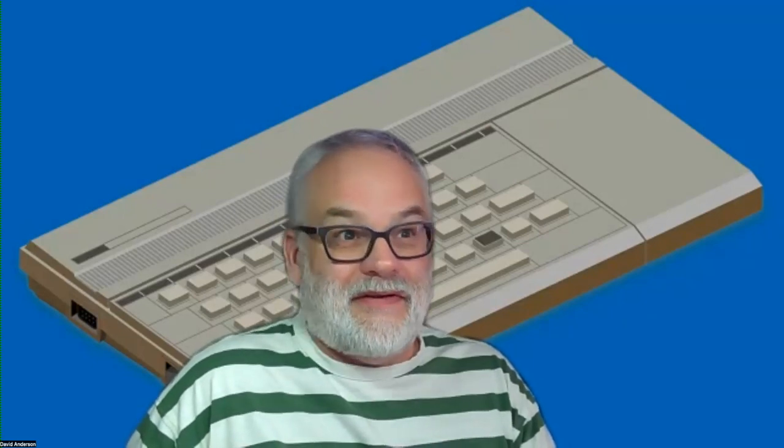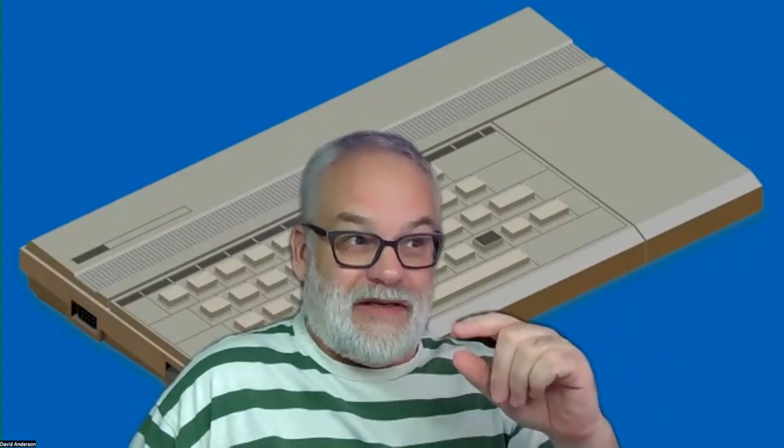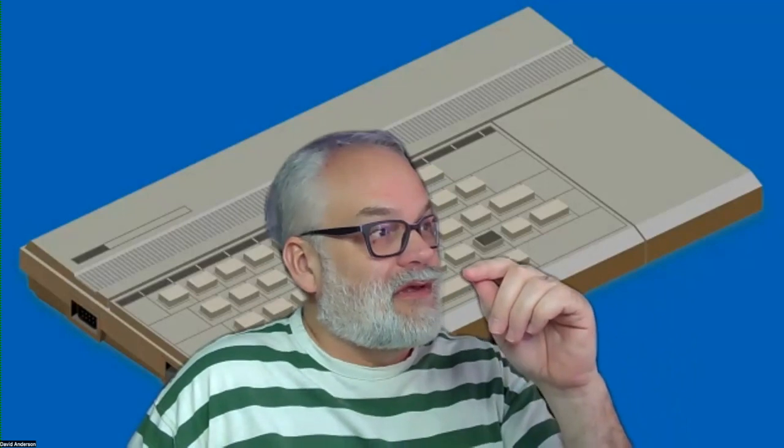Dick had a 1000, and one of the cool things about Audacity is you see the waveform as it's going across, right? And one of the things that I've noticed about Dick's 1000 is that the audio output has, I think, a 60 hertz ripple on it. So in addition to the waveform, it also goes up and down. And that makes converting difficult. Some of the things load in 81, which is another emulator. Some of them don't. I think there are tools to help take that kind of ripple out.